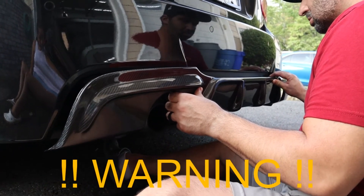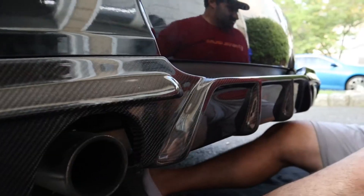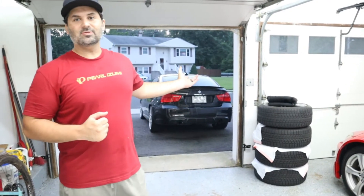The diffuser is in now — but warning: it will need some modifications. It will need a little bit of trimming. The clips that clip into the bumper are not the right size — they're too long, too fat. You've got to trim them, make them shorter because they're too wide for the holes. It doesn't allow the rest of the diffuser on the top part to clip in. On mine, the clips at the very ends did not go in at all, so the ends do hover a little bit. Just keep that in mind. It is super stiff — it's definitely made out of real carbon fiber. Be careful when trimming because there are shards going everywhere.